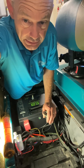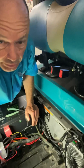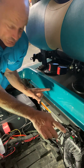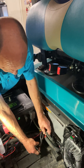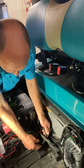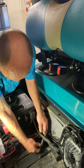The bucket harness comes in from your rear tail light, which is over here — right above your charger — and it joins down here at the bottom where it splits off; one goes to the left, one goes to the right. I'm gonna cut that zip tie and now I can see down in here — that is where my split is. Before the split I'm going to go into the thick wire and see how many wires are in there that split off to the two tail lights.